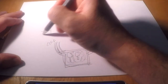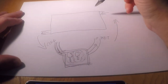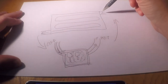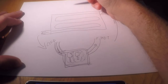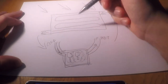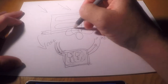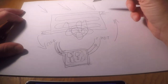So this is your radiator - your hot coolant comes in here and is fed back out of the bottom as cold coolant to repeat the process. Within a radiator you have a pipe that effectively does this - as the coolant moves around the pipe it's cooling down. That's helped by wind coming in from the front as you're riding forward, and at the back you've got a fan helping to blow cold air onto it.